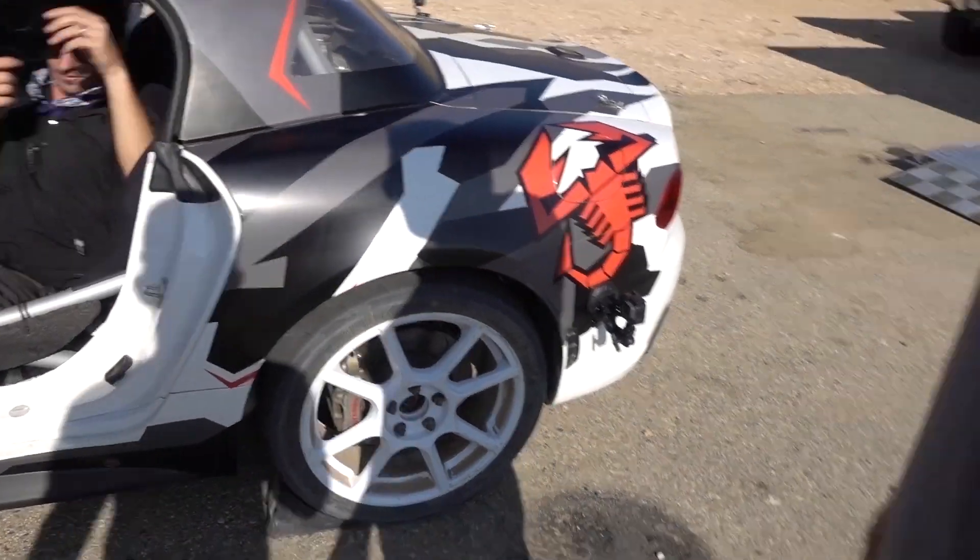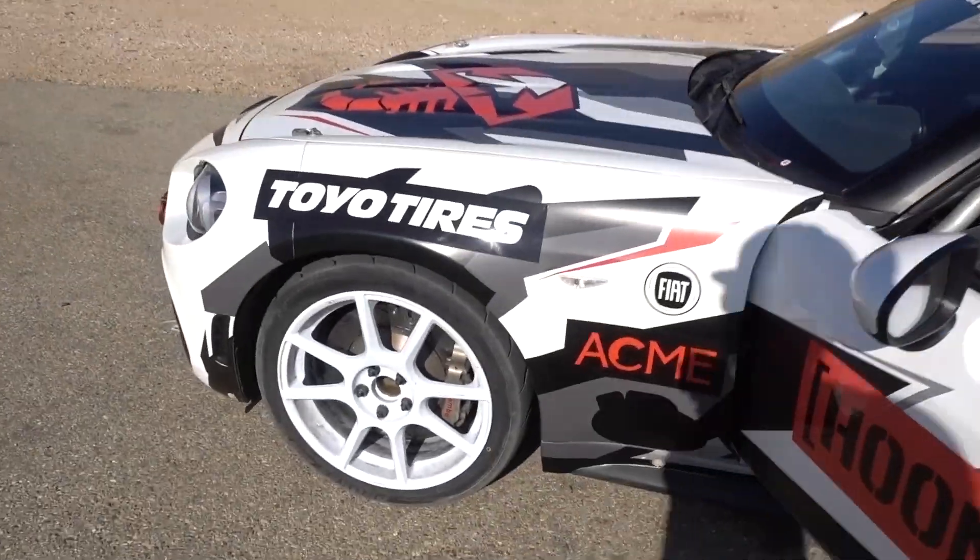This is Bert. Can you run us through the brake setup? It's a race setup — Brembo, 330 millimeter front rotor, 300 rear, four piston calipers front and rear. She will stop on a dime. The pads are RS-42s — it's a very linear friction material, so when it gets hot it just has constant grip rather than peaking very quickly. You want consistency throughout the whole stage. A rally stage can be 5 miles or 40 miles, so you need good consistency with minimal fade.